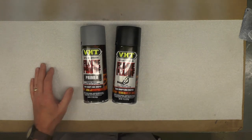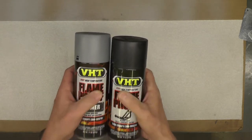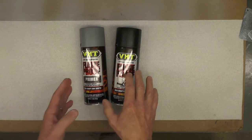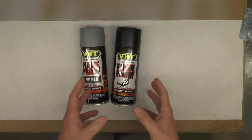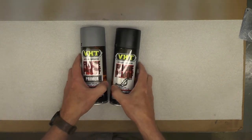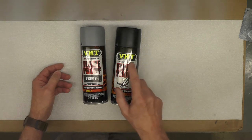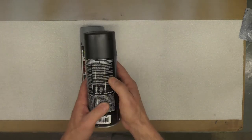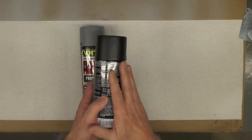The concern I have is that since it's a very high temperature paint — this is a matching primer and paint — it's very high temperature, and in order to cure it requires baking. There are two ways you can do that if you read the instructions: one is to bake it in an oven. My oven certainly isn't big enough to hold the exhaust system for this project. The other way spoken to on the label is to use what they call on-machine or on-vehicle baking.